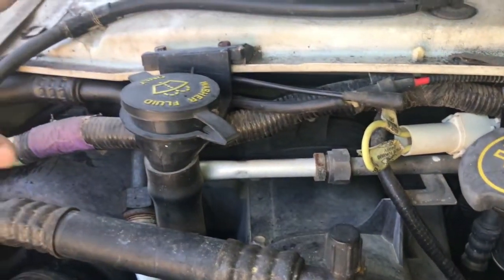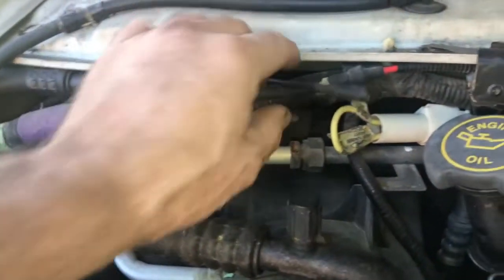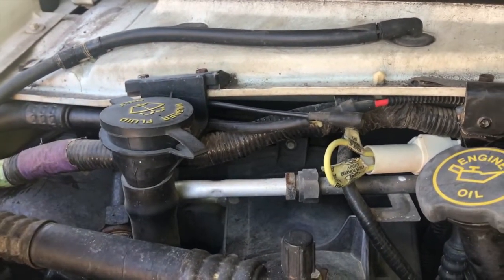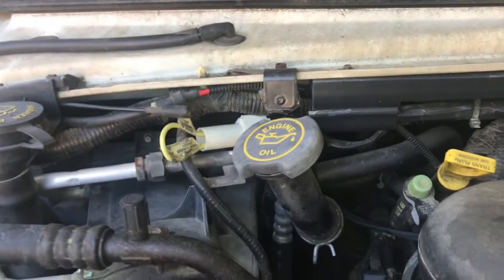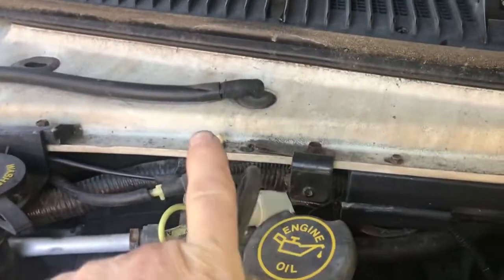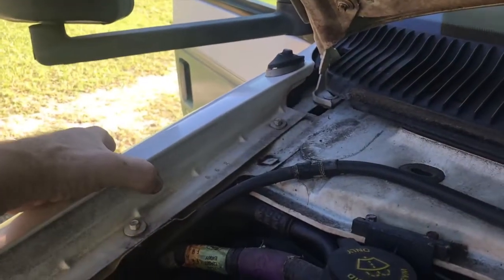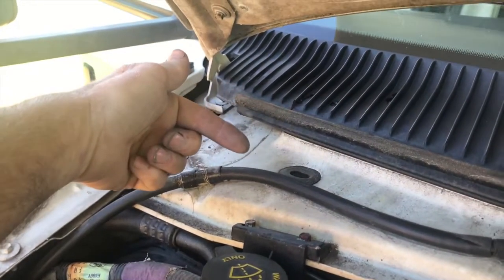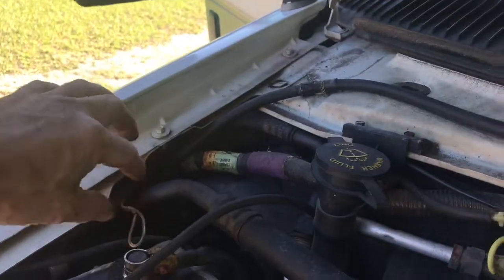On this vehicle, we're just not going to do that. We're going to bypass that canister and that valve. You could put the valve and a new canister right here and completely eliminate the old ones, but what we're going to do today is bypass it. I'm going to take a new vacuum hose and run it from here through the fender well, which is hollow between here and here, then up through the wall and back. I've already ran a coat hanger through here and up through.